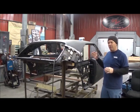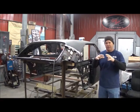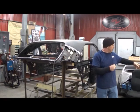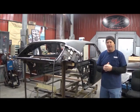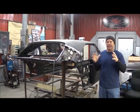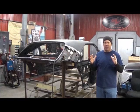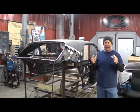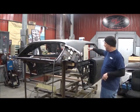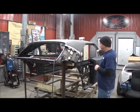I was working on the front of the car when I had it turned around and leveled out. I was going to build a jig to slip the body over the Hellcat and fit it back and forth as we go along. But there's a little bit of stress in the cab - not a lot, but a little bit. It only takes a millimeter of movement that I can't actually hold, so I'm going to have to abort that approach. I'll put a support across where I've got it locked in at about 1,555 millimeters right there across the window post.